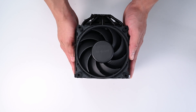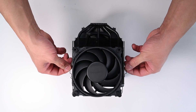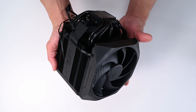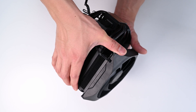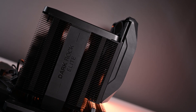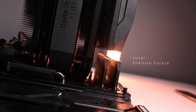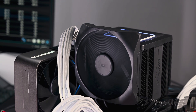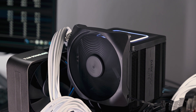One thing about the Pro 5 and Elite is that you can adjust the fans on both models to accommodate taller memory kits. The issue is it might throw off the aesthetics a little since it's not sitting flush, and it's also going to affect temps. I tested the Dark Rock Elite with the front fan raised all the way up, and we essentially bumped temperatures up by about 2 to 2.5 degrees on Performance Mode. Logically this makes sense because we're losing a bit of airflow with nearly an inch raised.